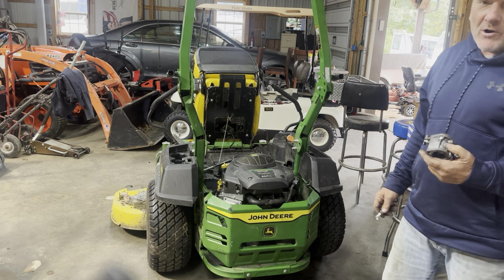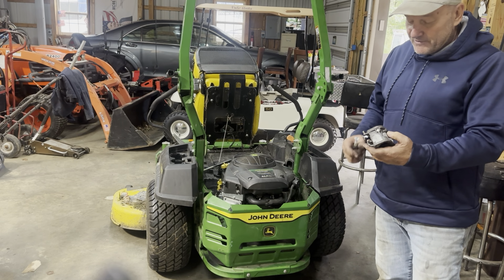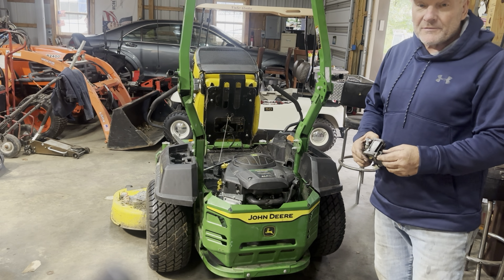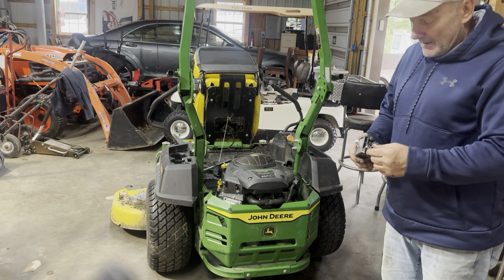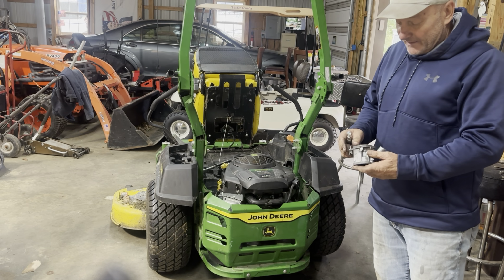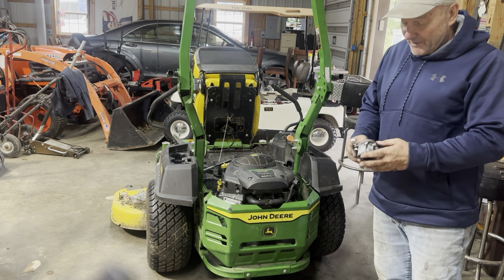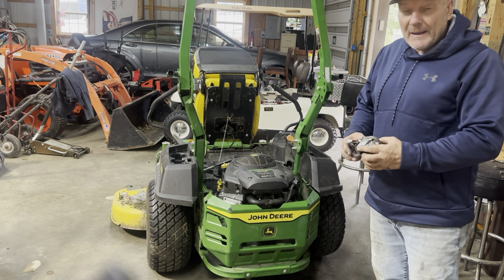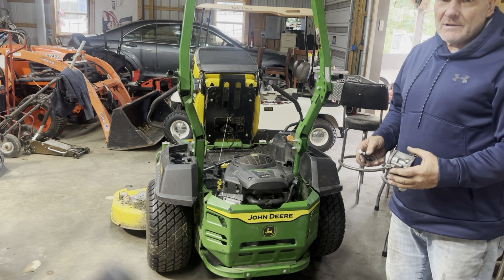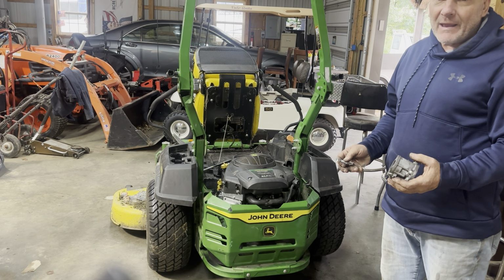And as we progressed forward, we of course took the carburetor off and started cleaning it, ran it through the ultrasound machine. After 2 attempts of cleaning it through the machine and hand cleaning it, it still didn't function as we wanted it to do. So we decided to order a new one from Briggs and Stratton, the supplier. And the carburetor we received was identified by both our main supplier and online.